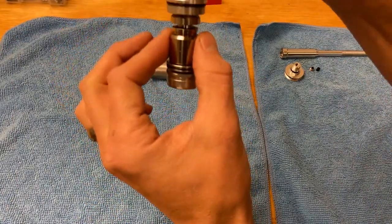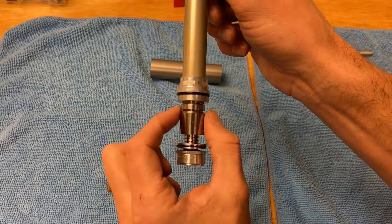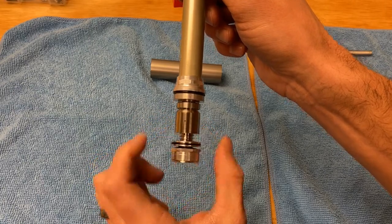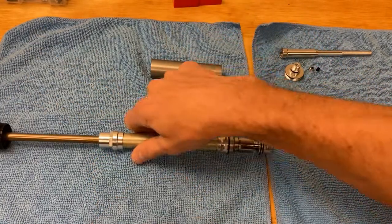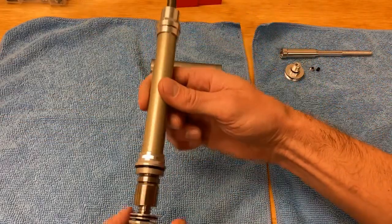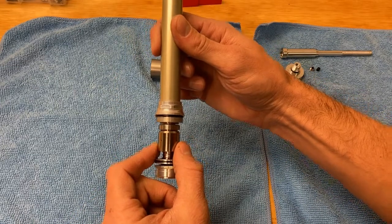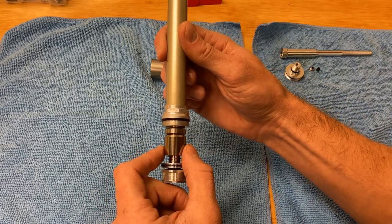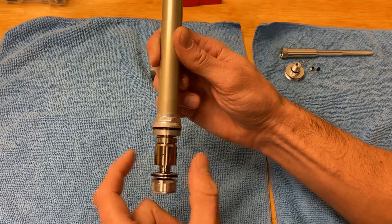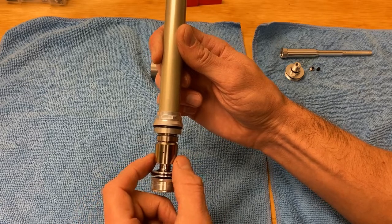This moves downward when you hit a bump. What this brass mass right here does is keep oil from flowing through some ports — I'll show you these as we get this apart. This is free to move, so as you hit a bump this has some inertia, hence the name inertia valve.